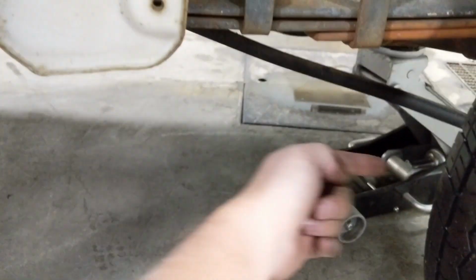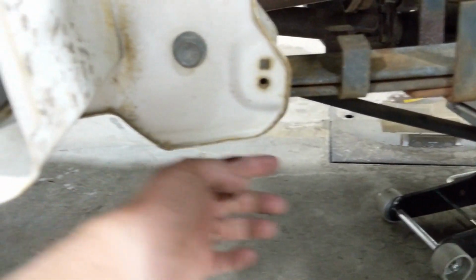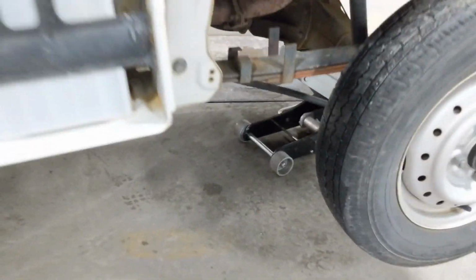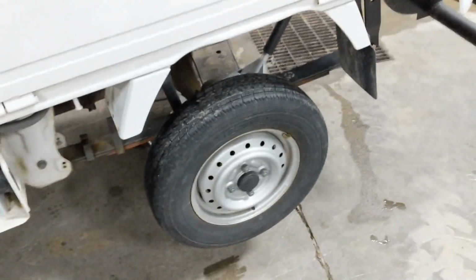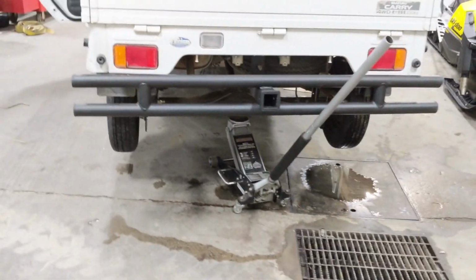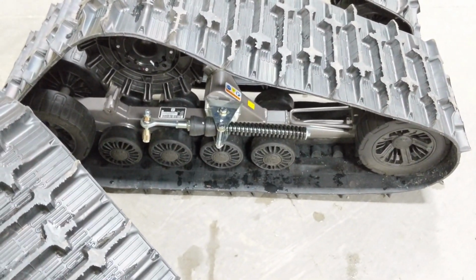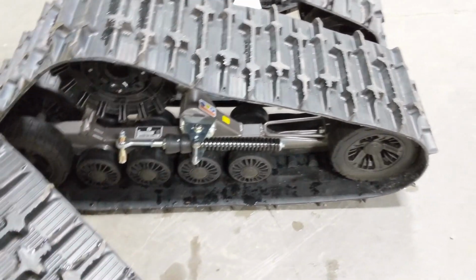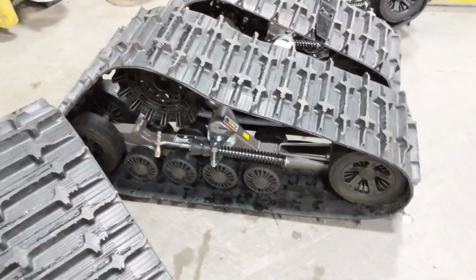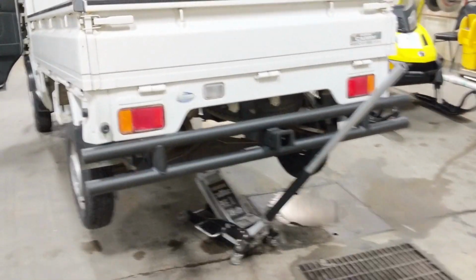The other thing is, again, you have this big long brace bar that comes off the front of the track or the side of the track around and mounts way up here. They rattle like crazy. There's a lot of play in there. There has to be just to have that proper motion. They rattle and jiggle and rattle. We weren't really a big fan of that, so we thought there'd be a really easier and simpler way to do it, and this works really good. Just order the independent suspension kit for the Camso tracks, and then just a really simple mount like we've done on the back there. I'll get it all jacked up, and we will see how to bolt these things on.